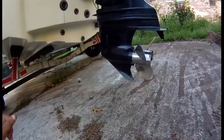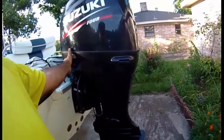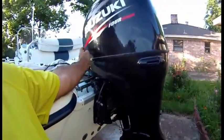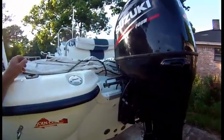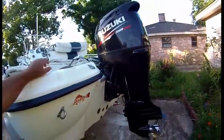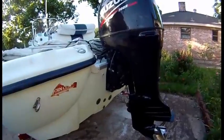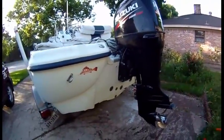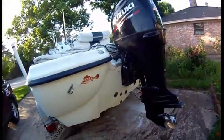Why do you want to do that? Because if you leave the motor in an angled position like most people do, the water gets trapped right there in the tilt. That little salt in the water will eventually destroy your boat. Most of the damage is done while the boat is in storage — you go out for 8 or 10 hours, then the boat sits for a month or two, and that tiny bit of salt will just sit there and corrode your aluminum. Yes, aluminum does corrode.